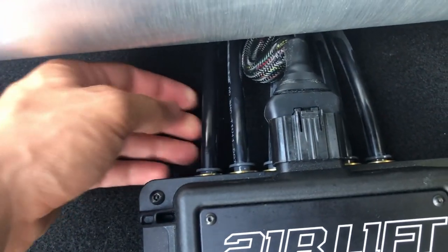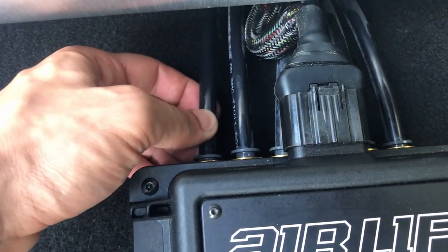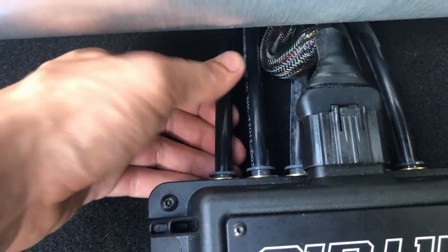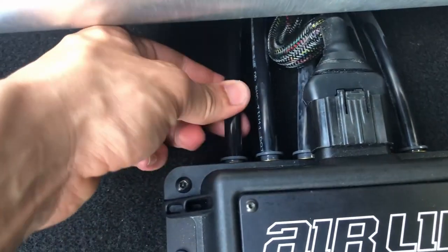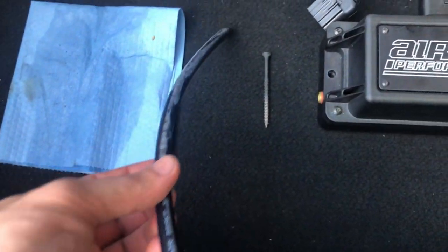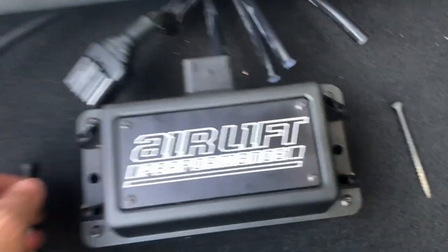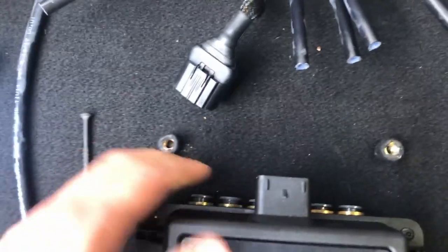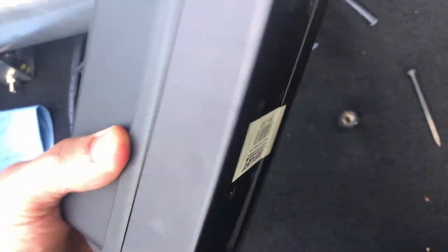If you're not sure how the lines come out, you literally just push the gray piece in and pull out — it'll come right out like that. This one's easy because it's the exhaust one. When you put it back in, you just push it in and it'll click and it's good. So I unplugged everything — all the wires, this one's really short, the exhaust is really short. I took this one off by holding it down and wiggling it off, took the two screws off, and now it comes right out.